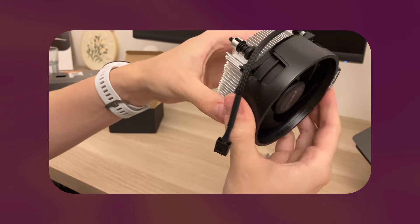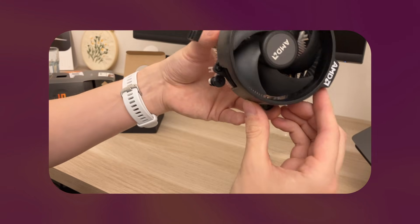It's a 6-core, 12-thread CPU built on Zen 4 with a TDP of 65 watts. It actually comes with a surprisingly compact cooler in the box. Conveniently, it has exactly the same height as the maximum supported by our InWin Chopin. I wasn't sure if this meant it was going to fit, but it did — thankfully. That saves us a lot of money because these low-profile coolers normally cost like 50 bucks. So this saved us around 50 bucks. Thank you, AMD.